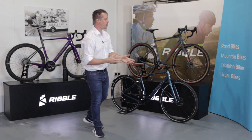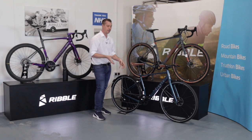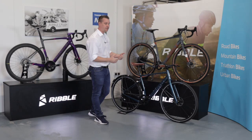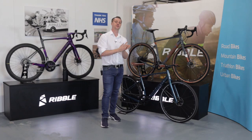With the power motor being in the hub and the cassette moving freely on its own free hub body, the mechanical drivetrain part of the bike operates just like a traditional bicycle. You can ride the bike in an off mode without any resistance or drag on the rear wheel, because it lives on its own axle and its own free hub. As soon as you require some assistance, you just turn the bike on and you immediately have your settable mode, freely available to get up those steep hills in your local areas.